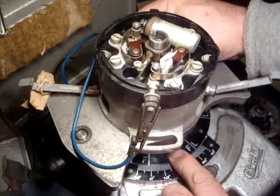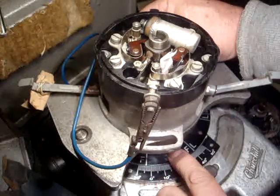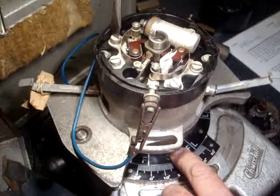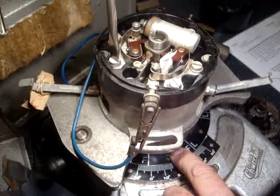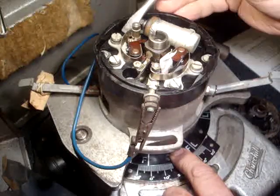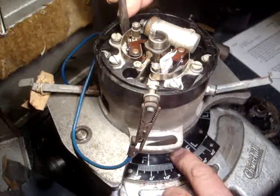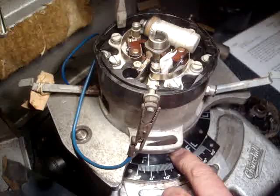So that's north, that's one, that's two - two degrees there. I'm going to slacken this right off so it's really easy to move. That screw's bent - you can see it. This is new old stock, this distributor. It's really easy to slide like this, so I'm just going to move it there - it's made the contact. Just going to bring the screw down once again, moving the screw.